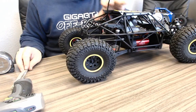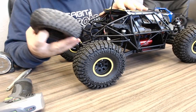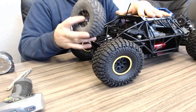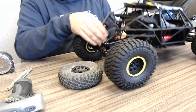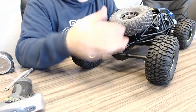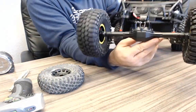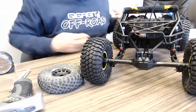Could you accommodate a spare tire on the rear during full shock compression? With a tire back there compressed all the way, it would probably touch the rear upper links just a hair during full compression depending on how you mount it. You'd also need some sort of mount back there to actually hold it. It's kind of cut out in the back of the cage to clear the rear axle coming up.